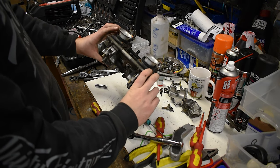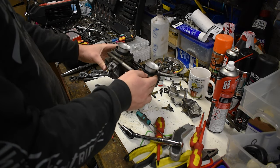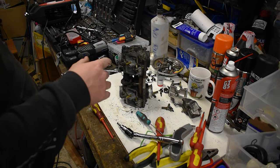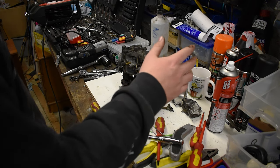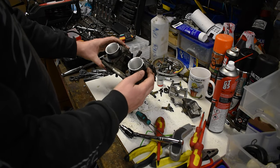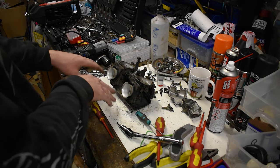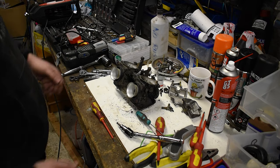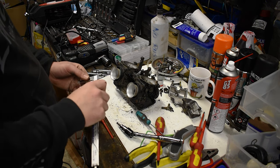I'm going to be really careful here because I want to show you something. What you're looking for is if that surface is no longer flat and smooth - if there's a ridge eaten into it. There's a little ridge eaten into this one but nothing too bad - you can see it is starting to go. If I can get them cheap enough I'll probably replace it anyway. Other than that this is as far apart as I'm going to take these. I'm going to put them in the ultrasonic bath and clean them up. I'll do two wash cycles - the first with old fluid to knock off the dirt, then full carb cleaner.